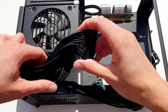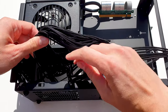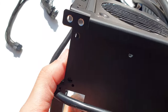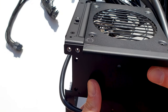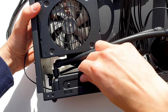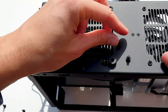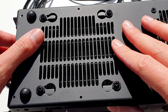I have the gold rated original Corsair SF600 PSU that comes with those ribbon type cables. Currently I have the premium kit, which is sexier, but unfortunately they are even harder to bend than the original ones since they are thicker. The easiest way I've discovered to install the rad without forcing anything is to remove the bolts that hold the PSU bracket, and this will give you an extra few millimeters of clearance so you can shove the radiator inside. The Asetek kit gives you two choices of screws, longer or short ones. The long ones you can use with the included rubber grommets that come with the case. I went for the shorter ones with the metal spacers because we need all the extra clearance that we can have for the radiator.